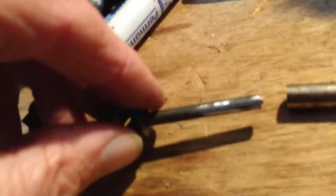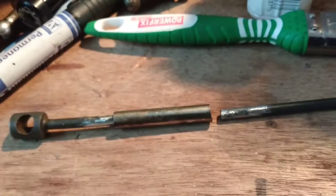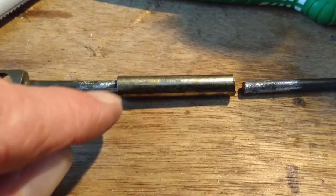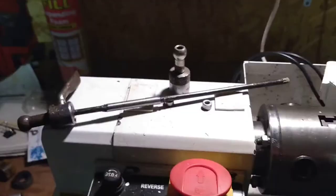That piece of grill just pushes in — it's a nice tight fit, fortunately, using imperial drills. I'm going to slot this because I don't trust my ability to do a neat circular weld. Slotting it means I get some weld running a long way as well, so it has good grip, and that will extend the skewer.